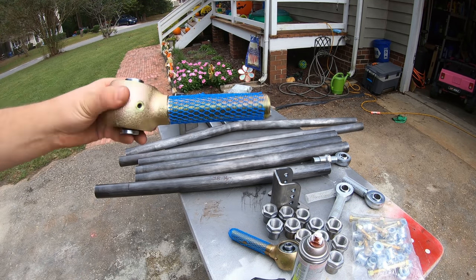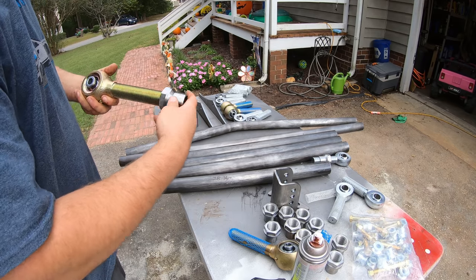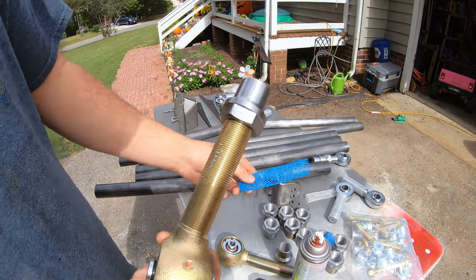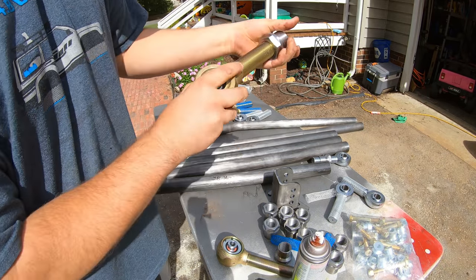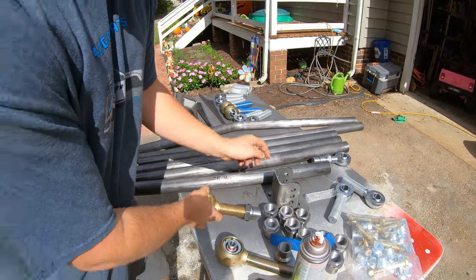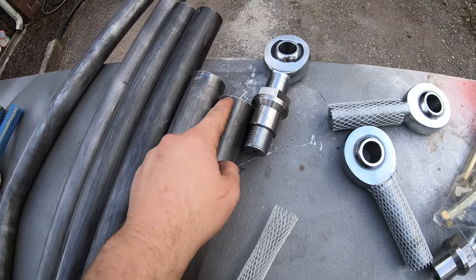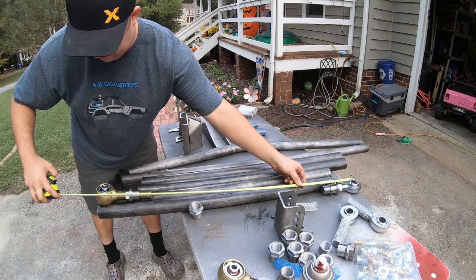That's where the offset enduro comes into play for the cross member end. I'll go ahead and mock one up. I should correct myself — the blue on the Enduro joint does not mean it's a left-hand thread, so we need to switch it up. The enduro joint is actually a right-hand thread, so we swap to a left-hand thread heim joint on that end. With the link mocked up with bungs right against the ends of our cuts, we can measure and confirm eye-to-eye we're reading 38 and a quarter.